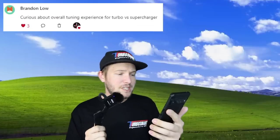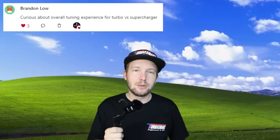Brandon says, curious about the overall tuning experience for turbo versus supercharger. Again, I would say the supercharger was much easier. To me, it's pretty much like doing an NA tune because boost is just fixed. You don't have boost control to worry about at all. That's the main difference between turbo and supercharged tuning.